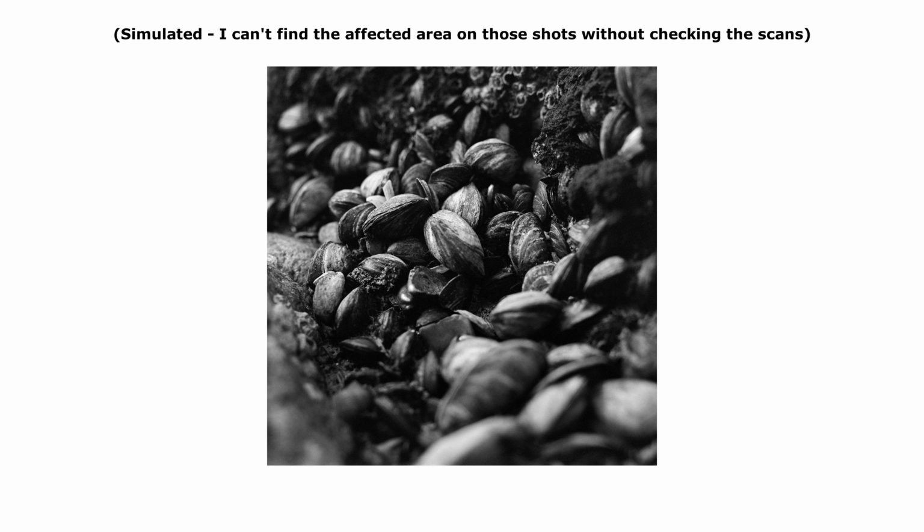And there were 2 frames where, yeah, one of them there might have been nothing, and the other one there was definitely a small overexposed patch that was small enough that I could just clone it out in Photoshop like dust. It wasn't a big deal. So by and large, it was a successful patch, and it's not perfect, but it's going to get me by until I eventually have to send this thing off for a full overhaul and, you know, get new shutter curtains installed and all that kind of thing.